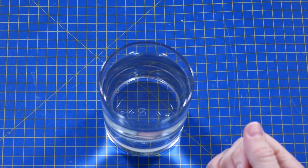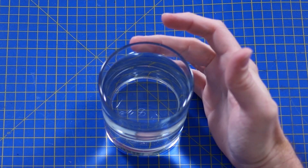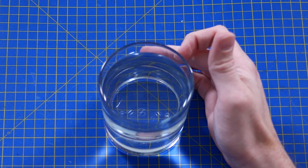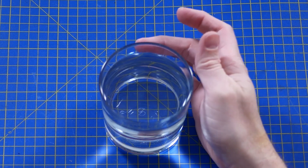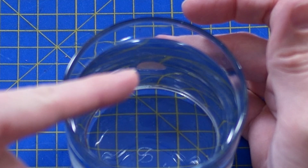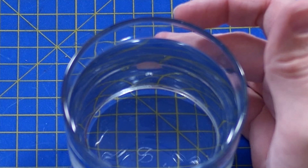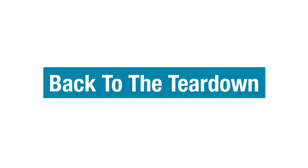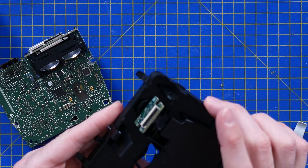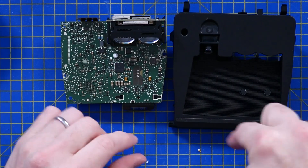I've got this glass of water here. You can see my finger through the glass - that's a transition of air, glass, air. But if I move my finger down so the transition is now water, glass, air, my finger is invisible and I can touch that glass and you can't see it. But if I wet my finger and touch the outside of the glass, the transition is now water, glass, water - and you can see my finger. That's frustrated total internal reflection, and that is the process cars use to detect when automatic windscreen wipers should turn on. The IR light bounces inside the windscreen and a raindrop hitting it reflects it back into the IR camera.